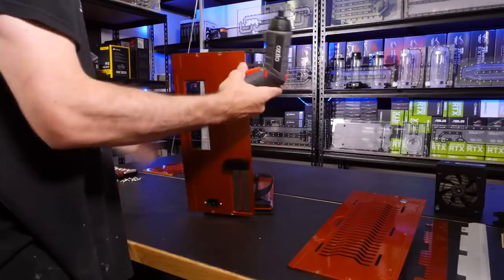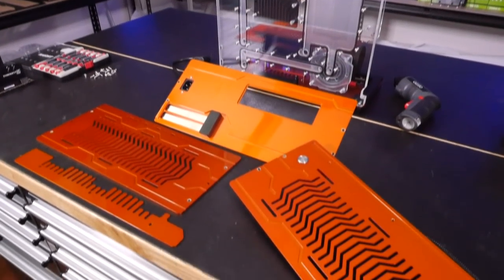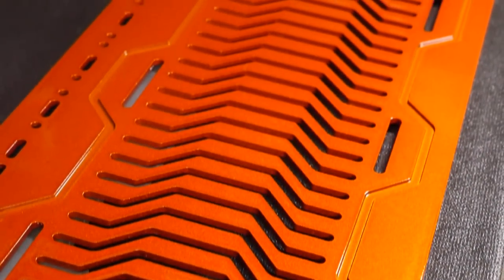So this is a high-end Wraith build, and it's custom. It has custom paint. This is an effect that I've done before. DNA silver flare, silver metallic base, and then candy orange over the top, which is semi-transparent. I just really like the candies.